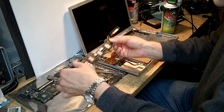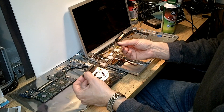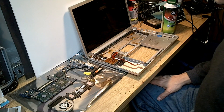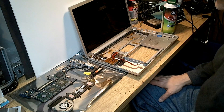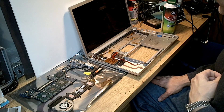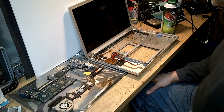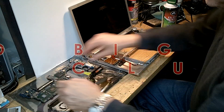This is a very elegant design — the heat pipe is a beautiful design — it's just that there's no easy way to clean it without completely disassembling the computer, which is unfortunate. One thing that could have been done is to put an inlet filter on this assembly to catch all the dust, with a removable filter feature where every year or so you could take the filter out and clean it.